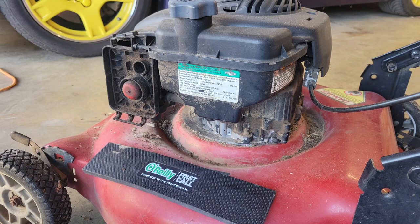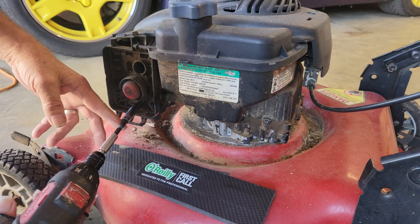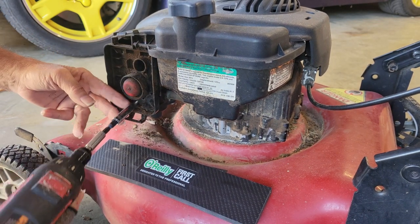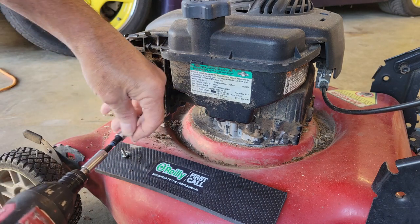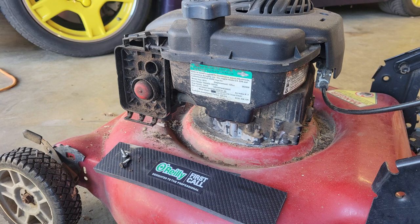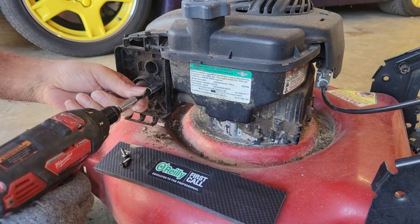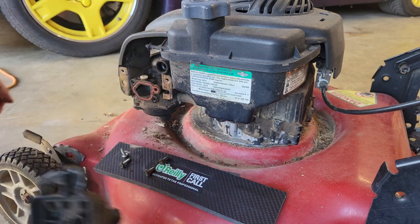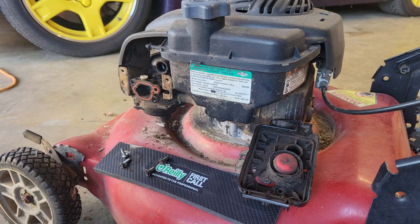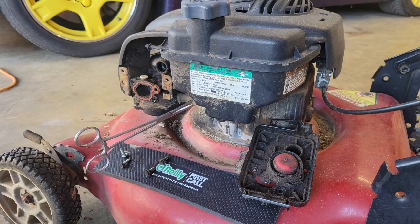Looks like they've got an invisible air filter on this one. You've got two screws that go into the carburetor and two screws that go into the base — I'll list the tool sizes in the description. Once you get these screws out, all you have to do is disconnect the fuel line and you're pretty much off. This one's even easier to take off than the other one. Go ahead and kink the gas line — that way we won't have any fuel spill when we're doing this.